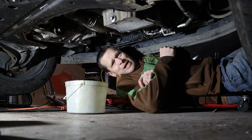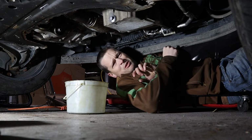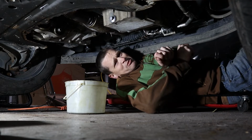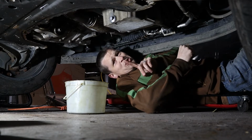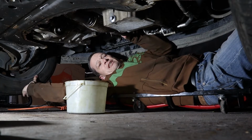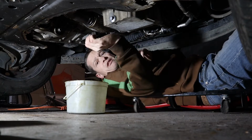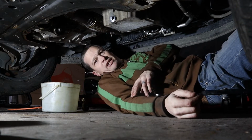Okay, I've got the axles back in. I bled the clutch a whole bunch more with a helper: pushed the pedal down, released the bleeder, closed the bleeder, released the pedal, and over again. Now the pedal's being pushed down by my helper, and look, you can actually grab a wheel and spin it in gear. So the clutch is releasing. That is good news, and we can carry on.